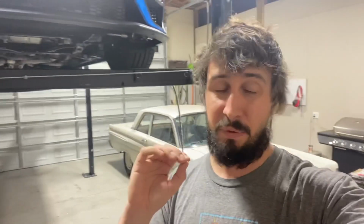So I had a little bit of camera trouble earlier, just a few things I want to reiterate. Basically, you saw me time the engine to 12 o'clock on the right-hand side, and I know I put it in red, but please, please, please, if you're following this video, make sure you then turn the crank until the keyway is pointing at 5 o'clock before you remove the left-hand side timing chain and tensioner, all that stuff. So just wanted to let you guys know that.